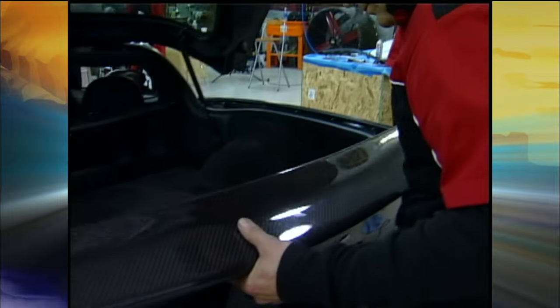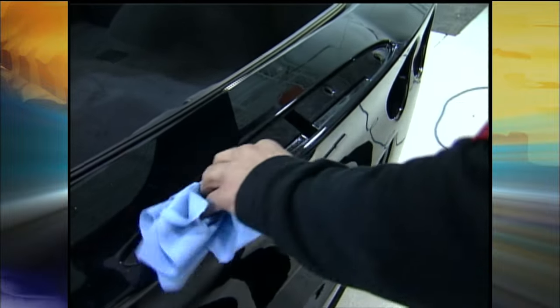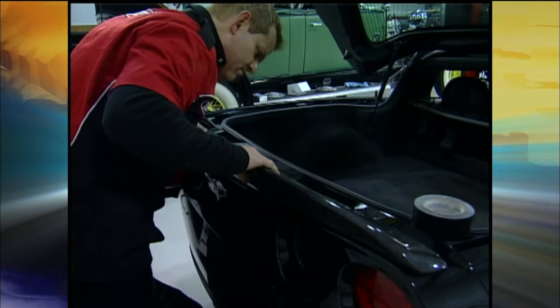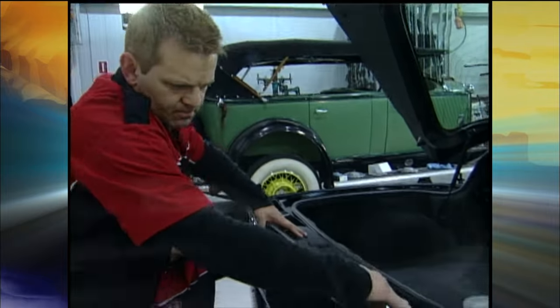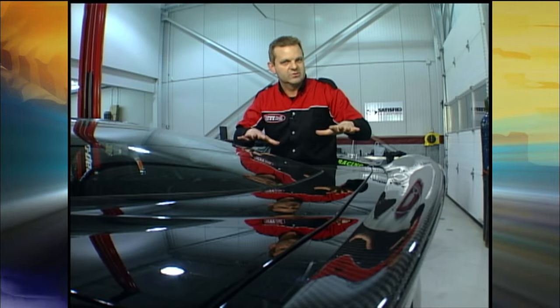The second part of our aero package is probably the most important element — the rear spoiler. Even though it's a simplistic-looking lightweight device, it greatly contributes to overall downforce. The install is quite simple: we use factory bolts in factory locations and a light adhesive on the outboard side for a firm structural foundation. In wind tunnel smoke trail testing, you can see the smoke trail come up and off the back of the rear spoiler — and in the wind tunnel, if the smoke goes up, the car goes down.